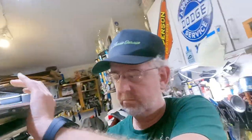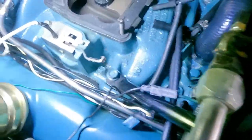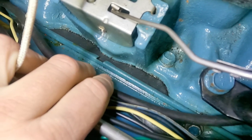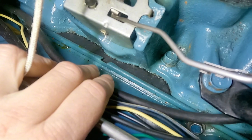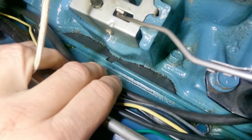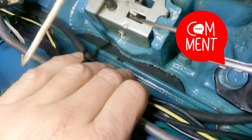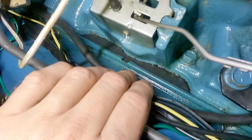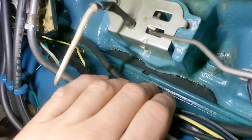This time when I went around looking, I'm taking stuff off and I have a light, and lo and behold, there's oil on top of the intake manifold gasket. Comment if you've had this happen before — I'm at a loss, because even before it didn't do that. It leaked into the cylinder, but this is blowing — it appears it is quite frankly blowing up that side of the intake manifold.